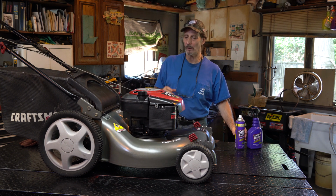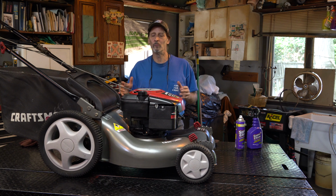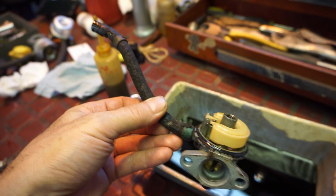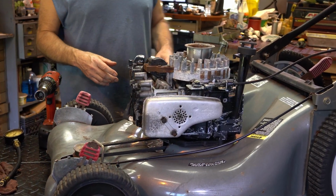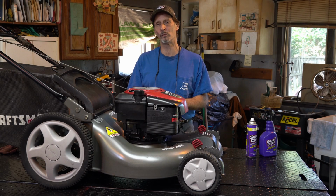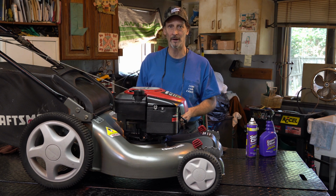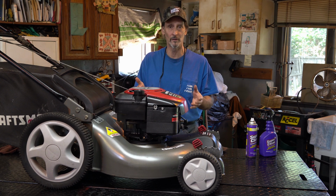It's also part of the next step, which is diagnostics. When you're cleaning it, you take all the tops off, and you're going to have junk in your fuel tank. You're going to have carburetor issues most likely. You've got to get all that out. You want to get the pull starter off. Remember, it's air cooled and it's oil cooled, right? The oil is for lubrication, but that oil splashing over the engine and the fins and everything is what helps to transfer the heat out of the engine, get it into the environment, and keep it lasting longer, keep the oil just a little cleaner, a little bit better, a little bit longer.